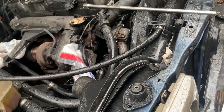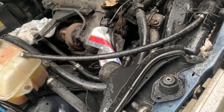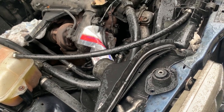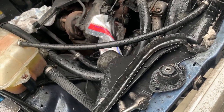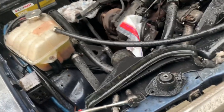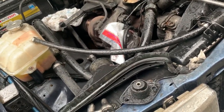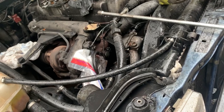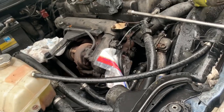That should work well. The only issue is there's a little slop in the bottom bushings, but that nut is stripped and I can't get it off, so it is what it is. If I had another good shock I'd just cut it off and replace it. I'm debating whether to order two shocks for it since I've got good mounts now. My understanding is the shock absorber helps with the shake when you cut the engine off - not so much a shaky idle - so I'm not too concerned.